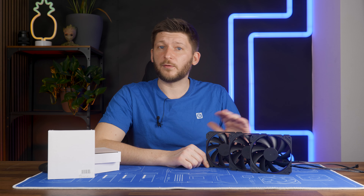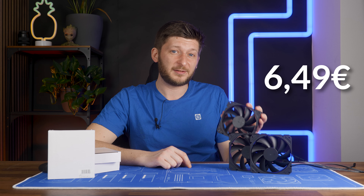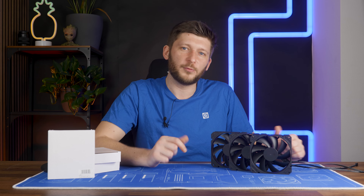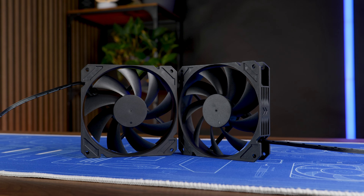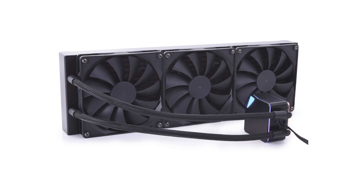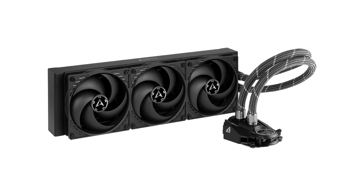But why am I covering this? Two reasons. The first is that the quickest version can spin up to 4,000 RPM, which is going to be fun. But mainly because of the price — this thing costs $6.49 on Alphacool's website. Six and a half bucks. It's incredible. That's Arctic P12 level of price-to-performance, and also kind of the same color choice. Plus, don't forget the enormous headroom you get with this compared to a P12. 5 degrees C in our benchmark is nothing to miss, but it does come with that pretty hefty drawback in the form of noise. Alphacool also started a Core AIO series with a stripped-down AIO using these fans, and I found that to be truly Arctic Liquid Freezer style, and I like that.